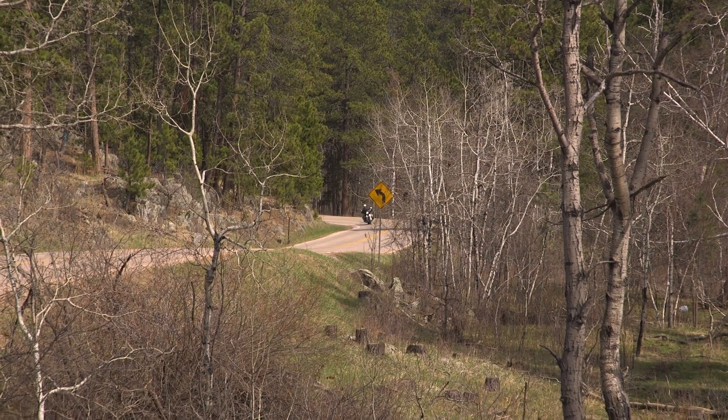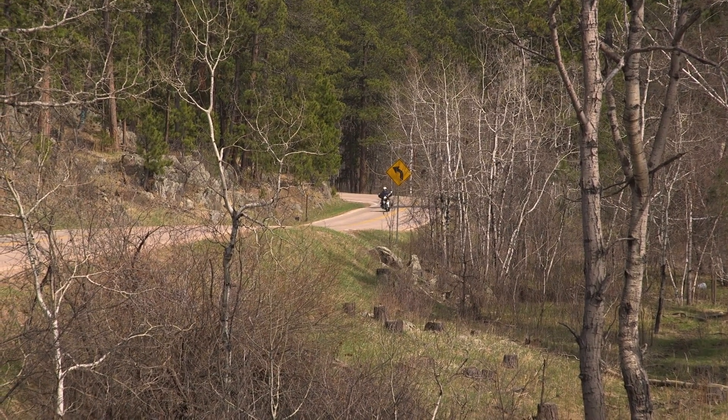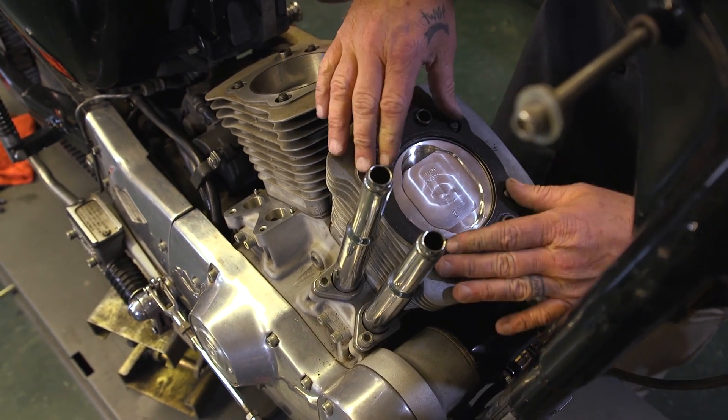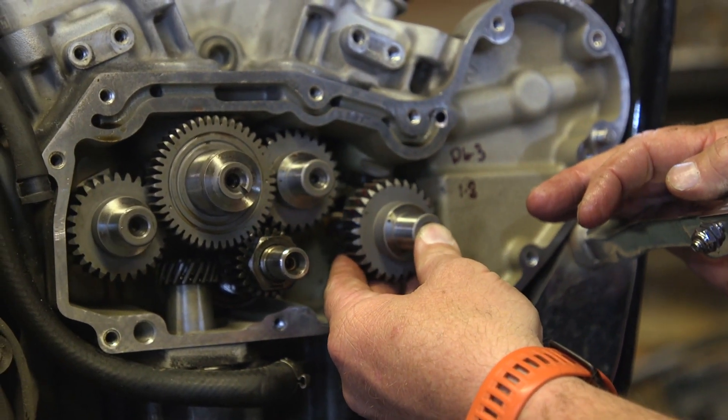The exhaust side will give you a degree of crankshaft rotation for the opening and closing of your exhaust valve. Those numbers will differ from the intake numbers — you're more likely to see higher numbers on when they start to open and close for an exhaust valve as opposed to an intake valve. In real terms for your engine on the street: if you have a lightly modified engine or you're putting a cam in a stock motor, you're probably going to get something that opens and closes a little sooner with less duration. If you're building more of a hot rod with a high compression piston, then you're probably going to lean towards something with longer duration and more distance between those intake opening and close points.